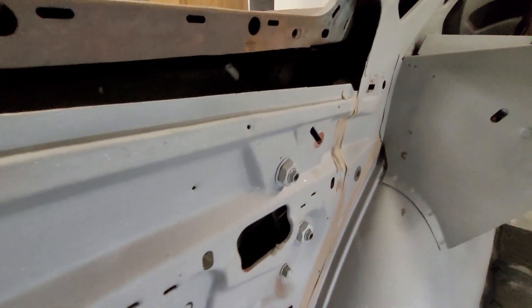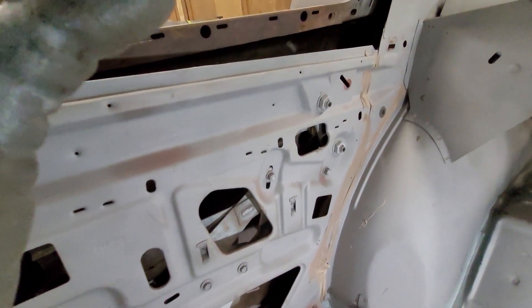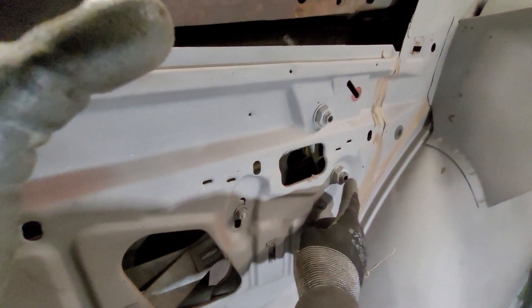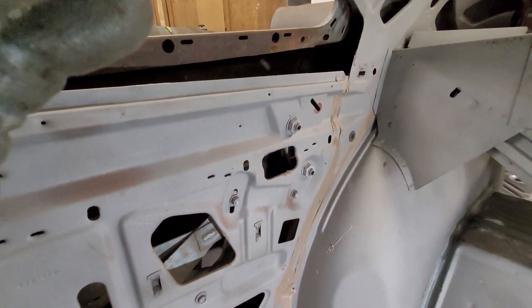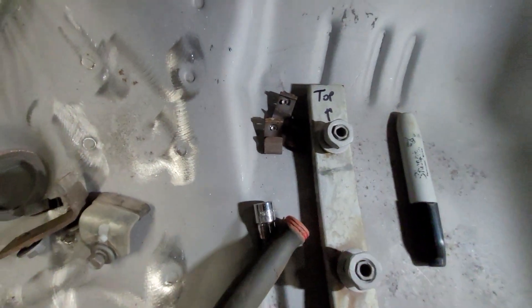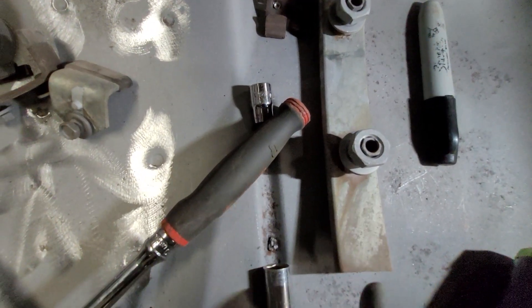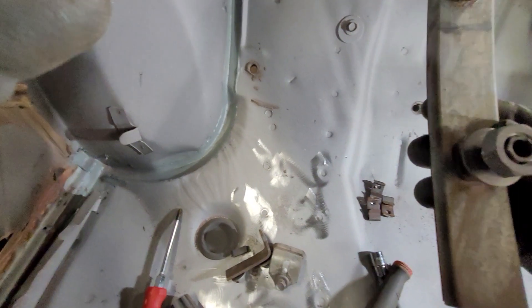Those two are out. Now I'm going to take off this rear guide right here — pulling these two bolts and pulling it out. I marked 'top' on it. As you notice, the spacing on each end is different, so you want to make sure you don't put it in upside down or when you roll your window down it'll come right up off the track. You need a little more track on the bottom. This is basically a track that a wheel slides inside and outside of.